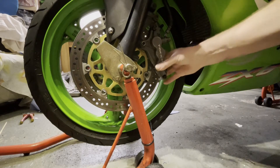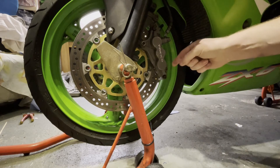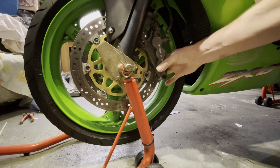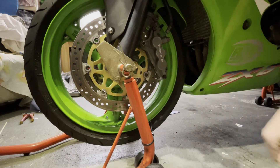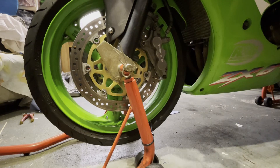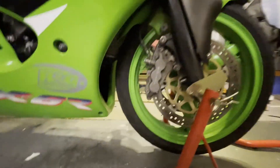I've refitted that now after rebuilding it again. It was the rings on the bottom two pistons there, which are both the 24mm sized pistons - they were both leaking. The other four were fine. It's been refitted now, I've left it overnight and nothing - nice and dry. Pleased with that. And on the other side, the leak from there is gone. I took it off the disc, opened it up, had a look, and couldn't find a leak anywhere at all.